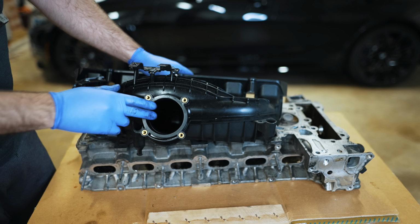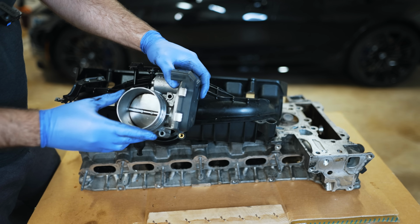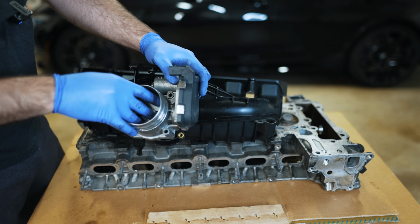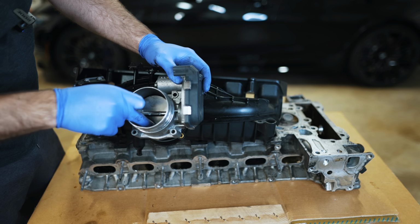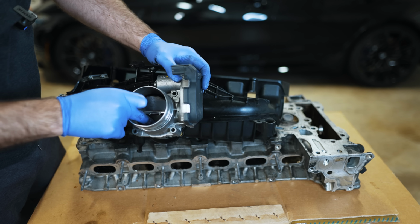You may be asking yourself, well, what's the major benefit for that? Why can't they just use a regular throttle body? If your valvetronic were to ever fail, then this would actually start to actuate. But really, is it efficient to have air trying to get around those two restrictive holes when you're just partial throttling? Definitely not.